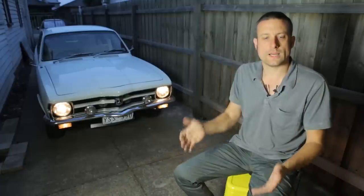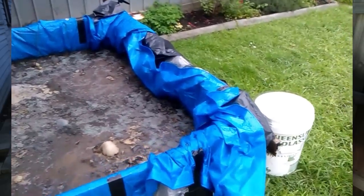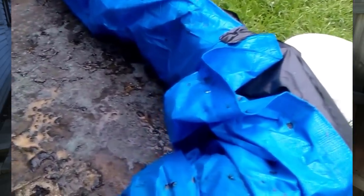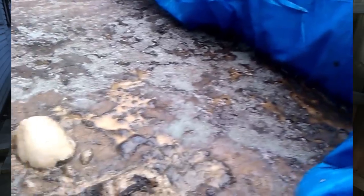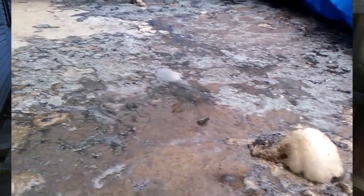You always want to lay your panels in there so that the rust is topside and none of those gases are going to trap. But sometimes this is not possible, and you also want to consider if your vat is lined with a skin or a plastic or a tarp — you don't want to puncture that. You have to keep those sharp edges off of it.